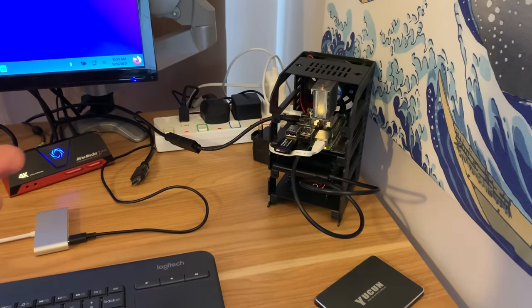Okay, so let's start up SD card copier. I've got other videos on how to back up SD cards and compress and things like that, but I just want to do a straightforward copy. So SD copier, copy from device. Well, this is the 128GB micro SD card. Copy to device. Handily, it comes up with Samsung flash drive, so I know exactly which drive. Sometimes it's a bit confusing as to which drive is which, so you've got to be really careful on this point. Right, hit start, and yes. And that's going to start flashing that operating system over to the USB stick.